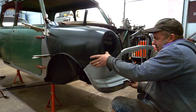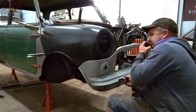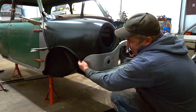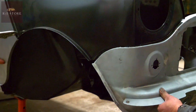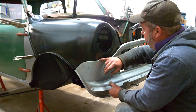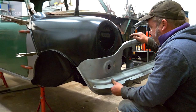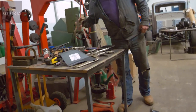So what's your point of reference then? Well you've got holes in the subframe, these are reference points on the inner flitches, but they can be wrong as well. Basically just making sure all of that — see that line there — if you took that wing back off and laid it on that it still wouldn't fit whatever you do, because it's tight there, you've got a gap there and a gap there. So you either cut that, or I've got another set of wings over there I'll try, just to see how bad these are, because they weren't genuine heritage ones.